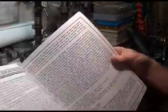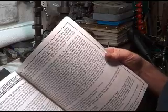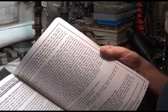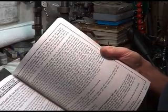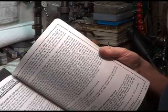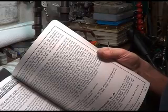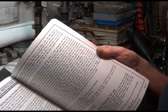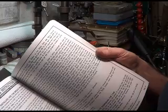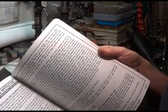Reading from the Berg book, installing the cam and cam break-in. It says always check the end clearance on the cam to cam thrust bearings. This measurement must be done with both the thrust bearing in place and the case bolted together. This can be done with a fine 400 emery cloth around a three corner file. Care must be taken not to make the thrust oversize, causing too much end play.